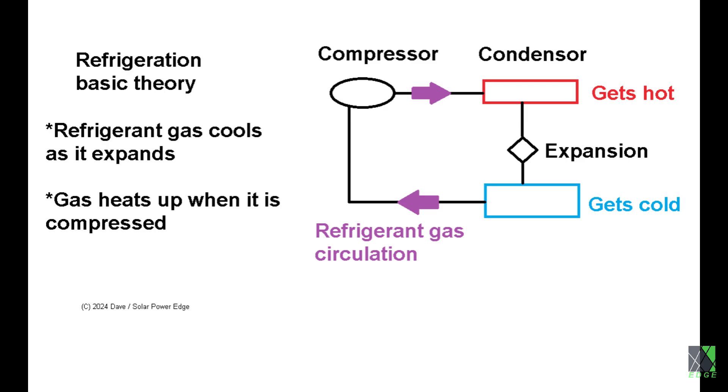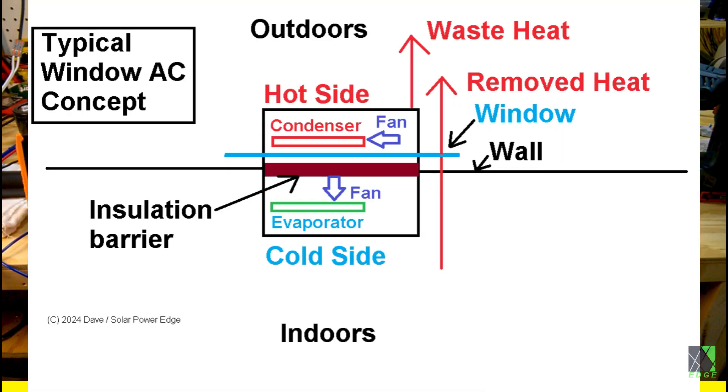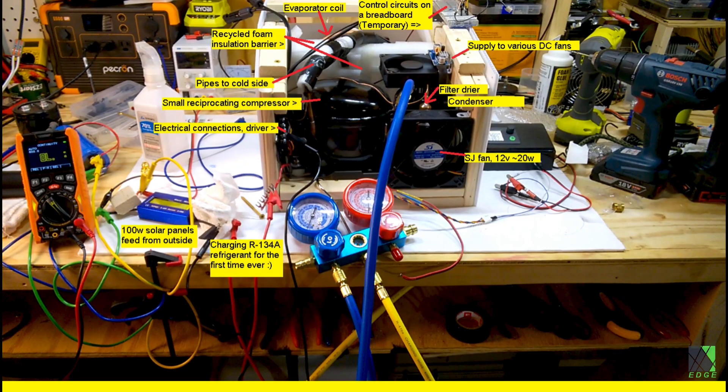There's always something new to learn. I didn't have a lot of liberty to film while building this project but I got a few photographs and clips. Basically I built a wooden frame — it's a prototype — and placed within it the compressor and some fans, closing it off using plastic boards. The frame is divided into two compartments just like a window air conditioner: the front part is cold, divided by a thick layer of recycled foam from the outside hot side. This prevents heat from creeping past the window and lowering efficiency.